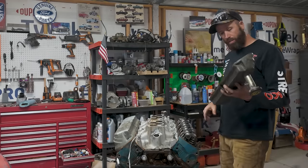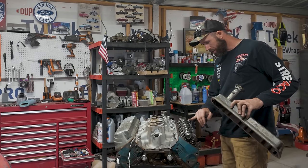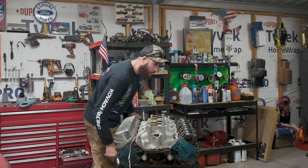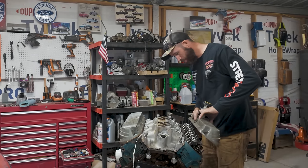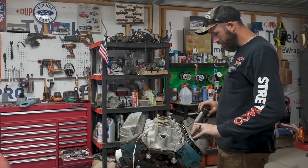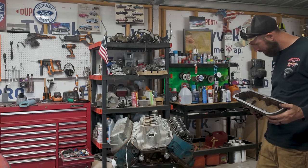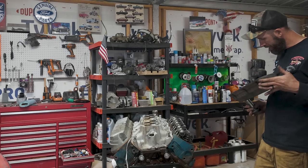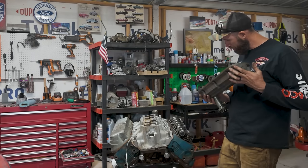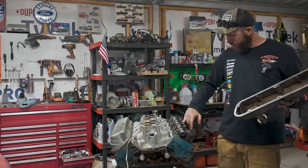Beautimous. Now, let's see. Let's get this rocker at its highest point. I think the only contact issue is actually going to be the poly lock, but let's get it all the way up. Just in case, so we know. Okie dokie, moment of truth. This is without the cork gasket, so it's gonna be like worst case scenario. Oh yeah, heavy contact. But where, you say? I don't know. That's a good question. Right there, by God. There's a rib that runs down the center of this thing that it appears to be striking. Let's take out this baffle, see what we got.